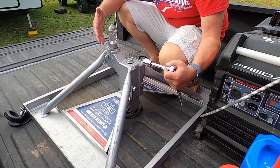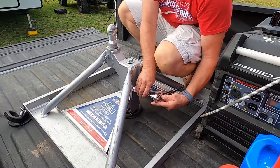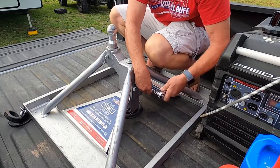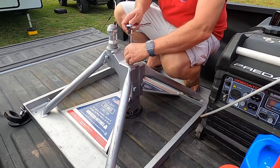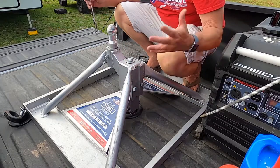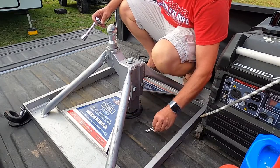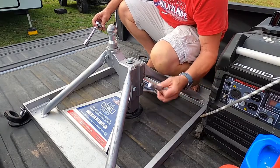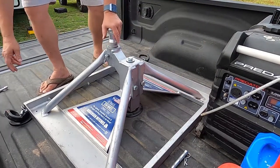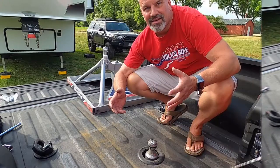The first thing I'm going to do is remove the Anderson hitch from the truck. I'm going to loosen the three bolts — there's two on the side and one on top. You only have to loosen them; you don't remove them. Then there's a cotter pin down here that's holding it — that one you do remove. I'll remove that and set it aside. And then theoretically I just lift this up — even I can lift this up, it's only 35 pounds.